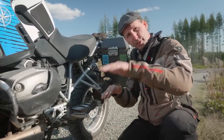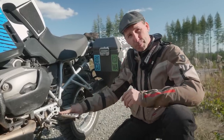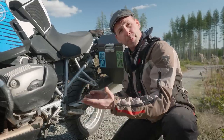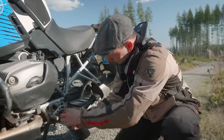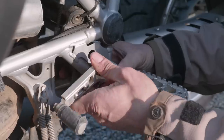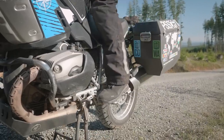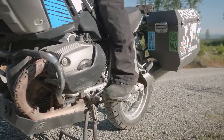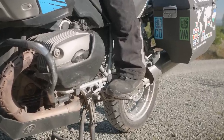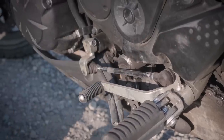When we're riding and need to downshift, we can just tap the top of the lever. There are two basic configurations. This one is set on splines with a pinch bolt at the bottom. I'm going to remove that pinch bolt, shift the lever up one spline, and that will give us just enough height. Once it goes back on, it's much easier to get underneath it and I can still get up on top of the lever. This is the halfway point between off-road and on-road. Don't forget to put your pinch bolt back in.